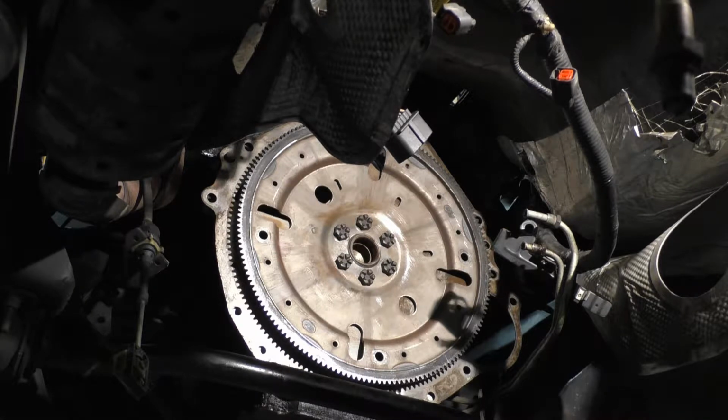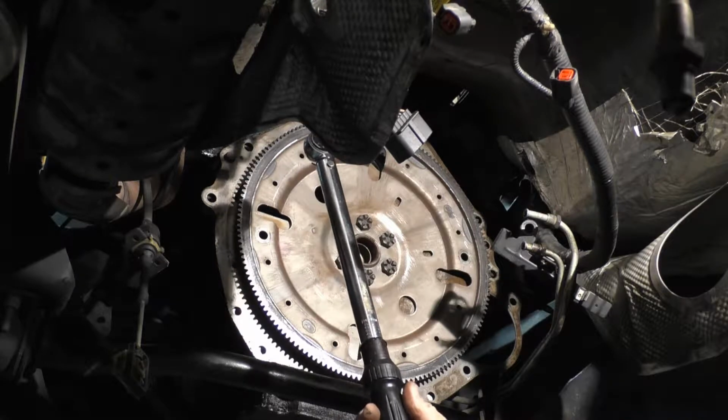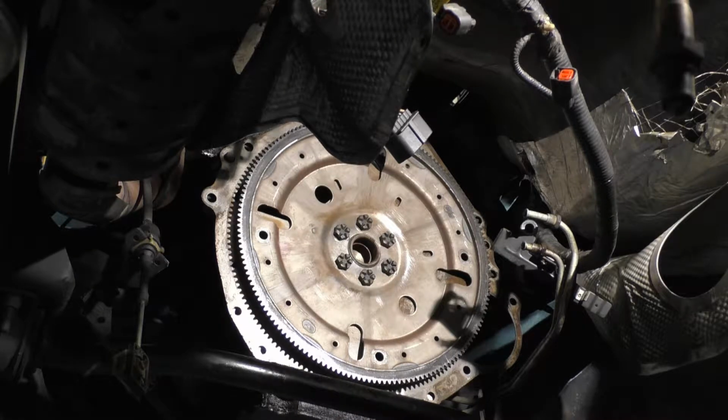So now we pre-tighten the bolts. It says these bolts torque to 59 foot-pounds. And something I guess worth mentioning, throughout my entire career, I've always unloaded a torque wrench when I get done with them. Meaning roll them back to zero, or whatever the lowest number is. Don't leave them sitting on a torque setting. I don't know if that makes sense to you, but I've always done that throughout my career, and I will continue doing that same thing.